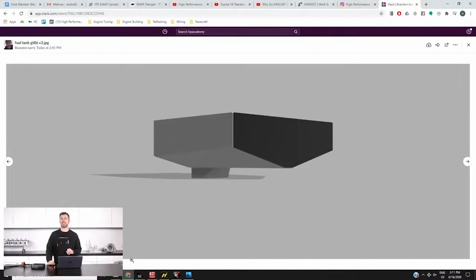I wouldn't really want to be sitting there for any length of time, but because it sits in that location, you've got a drive shaft running through the middle of it, so it is a saddle tank where there is about half of the tank on each side of the drive shaft. That's not really a big deal for a production road car. There's a siphon system that draws fuel across from the right hand side of the tank to the left hand side, which is where the surge tank and fuel pump are. Then of course it's pumped through to the engine.